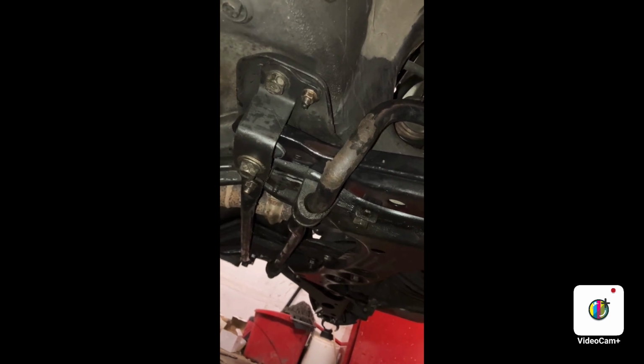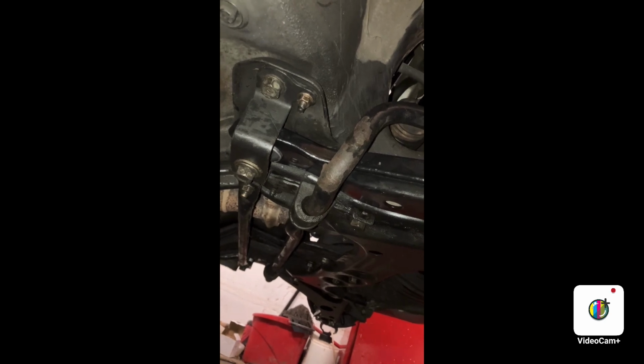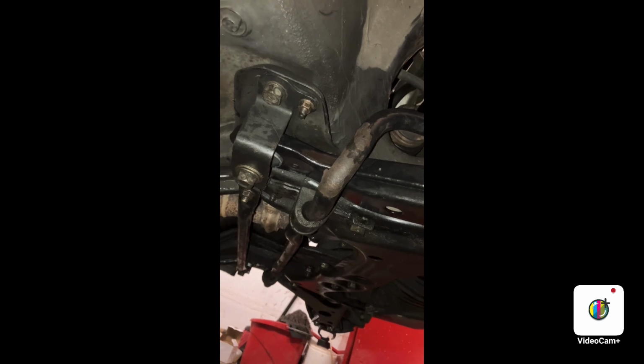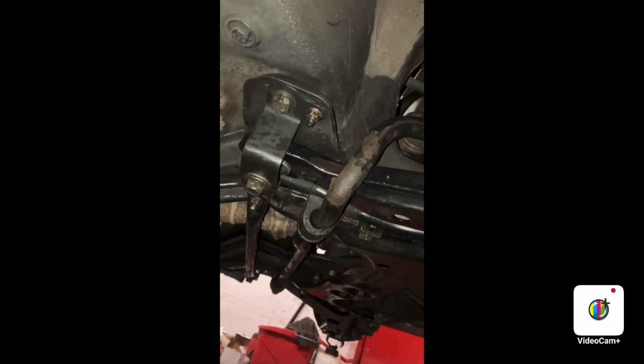And I'm tired of torquing, so I'm going to iron tighten, and I'm at a quarter turn, and then I'm gonna zap the bigger bolts, the 17s and 19s, with an impact gun just once, for good measure. We got the ball joints tightened up, and then we also tightened up the end links, and everything's all buttoned together. Now we put back the outer tie rods, and we counted. So this side, on the left side, I went in 10 times. And the other side, I did 14 times.